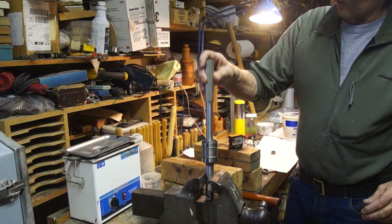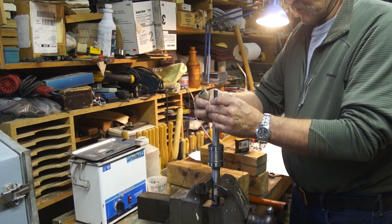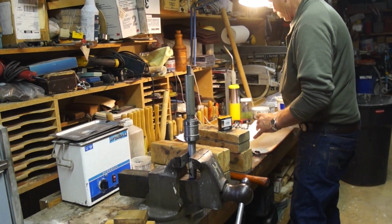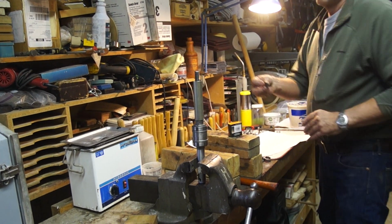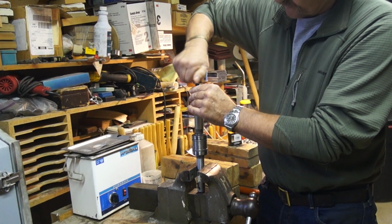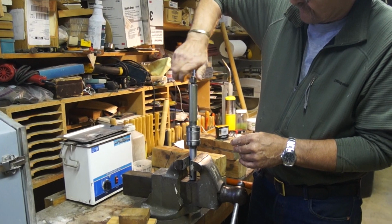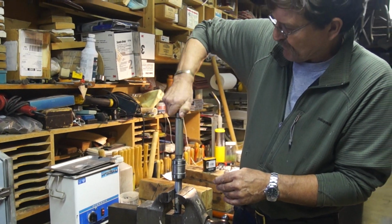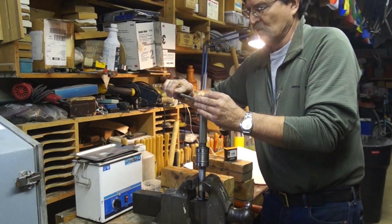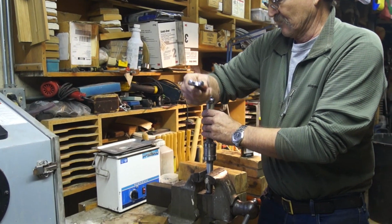And then we'll see if we've got a wheel tube that fits, oh, nope, too short. So we'll put the other top hat spacer on it. Now it fits. Okay. Washer. Basically, you do this test with everything clean and maybe a light film of oil on the bearings. You don't over torque it, you just snug it up.